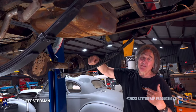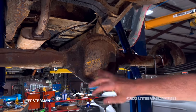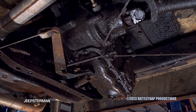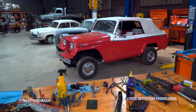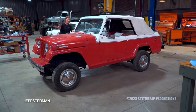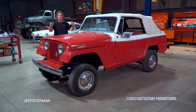They're also necessary to get a 15-inch wheel to clear those new front disc brakes. While you're under here, now is a good time to check and see if there's anything else you need to repair. We're going to replace the fuel tank, but look — there are dirt dauber nests all over the back of the rear end and down the frame, so that'll all need to be cleaned up. There are also leaks in the rear end, leaks in the transmission and the transfer case, and some rust holes in the rockers — but we're not going to address those right now because that is a level two. With the original tires back on, you can see what a difference this lift makes — it's finally sitting level for probably the first time in 40 years, and now we've got room to put up to a 30-inch tall tire. You've got options: go the original hubcap route or put a custom wheel on — anything you want.